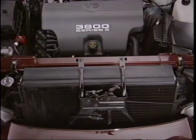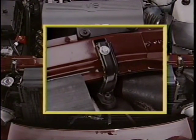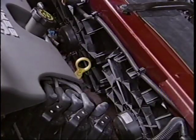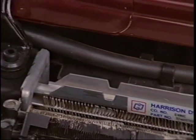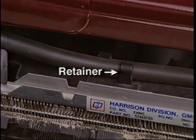There are a number of improvements in the radiator area of the engine compartment. The condenser radiator fan module utilizes only 2 threaded fasteners and brackets. It mounts in mid-rails to improve structural characteristics, and the fan assembly snap fits to the radiator. Overflow hose retainers are molded into the fan shroud to eliminate separate fasteners and reduce assembly time.